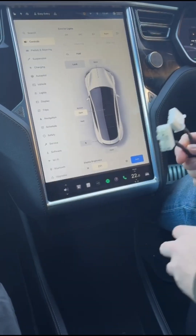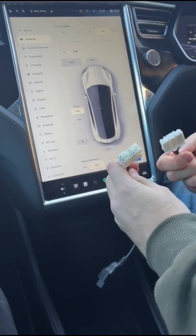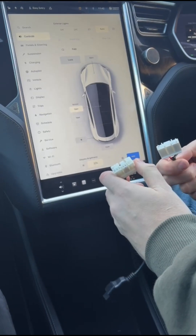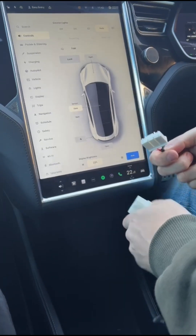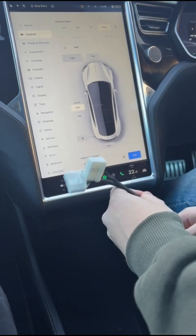In the Tesla Model S there are two types of cables: the 20-pin and the 12-pin. The 20-pin is usually 2015 and newer, while the 12-pin is usually pre-2015. There's a cut-off date around August 2015, so you need to check the connector yourself before ordering.